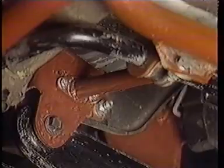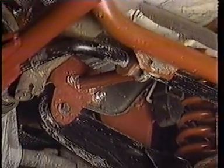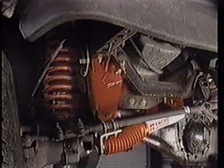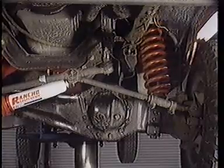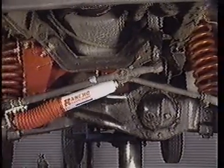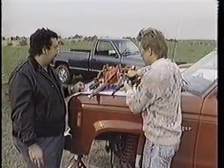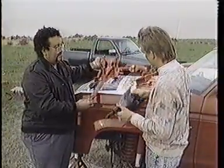Well, we went in with a longer than stock radius arm. We went in with a new sway bar cross-member mounting system. We had to go in with new lowering beam brackets, radius arm brackets, urethane rear bushings, a new steering arm, and coil springs. It's pretty obvious to see there's a difference between the stock radius arm and the Rancho.